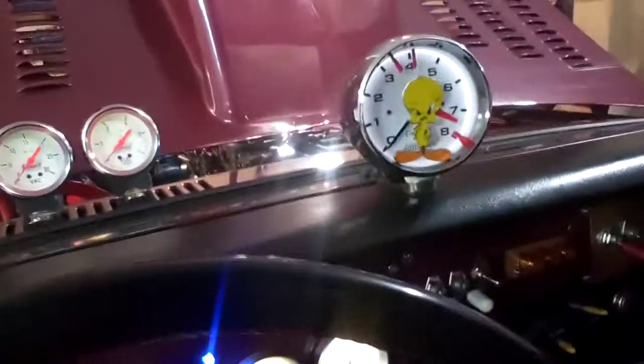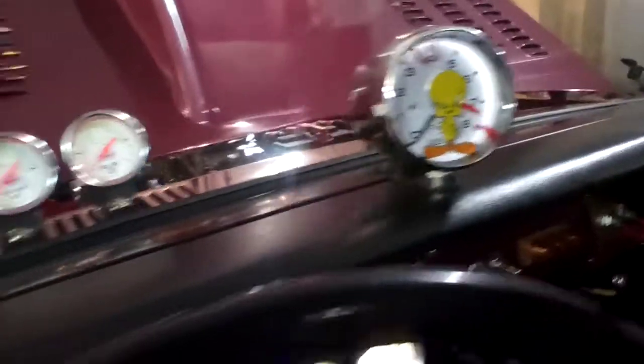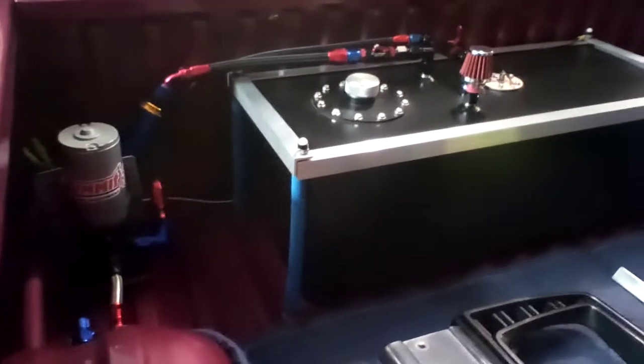I have a video where I'm actually revving it to 8,000 RPMs. It's a 1982 Plymouth Arrow pickup truck. TH350 transmission, Dana 44 rear end, and also I changed the rear end to 3.07 to get the RPMs down. Crazy thing is, it still pulls like a bat out of hell, and will still burn the tires. First, second, I can get rubbing third gear.